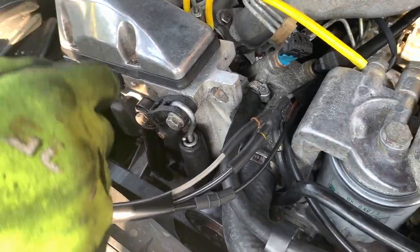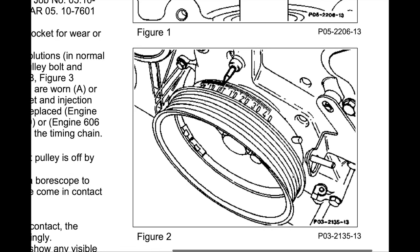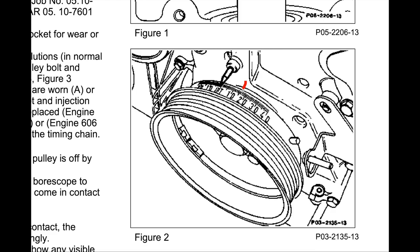Number two is your timing for your injection pump, which also runs off of the same timing chain, so you're going to have to set that up as well. The injection pump timing, however, you need to time it to 14 or 15 degrees after top dead center. It's very important that you remember it's after top dead center, because some people will time it to 15 degrees before top dead center or to zero, and the engine will still run just barely but it won't sound good. After top dead center, taking into consideration that the crank rotates in normal engine rotation direction, would be right around the 15-degree mark, between the 10 and the 20.